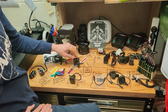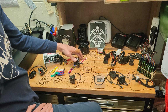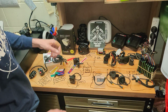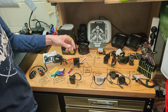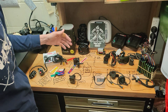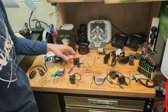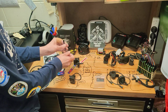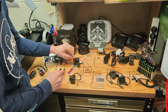This one here then, the second switch, you could say perhaps it's not needed because an auxiliary output can be just provided full-time, all the time power, or when the NFC is turned on, or the scooter's turned on, so power on or always on, as a wire that can come out with a plug on it from here and here. So if it doesn't need to be switched, then we could do that, in which case we just purpose these as NFC. And if you don't want the NFC, you can put a little patch cable in, which basically takes out the NFC wire of one of the 3 pins, disables it, so you can essentially disable that functionality.